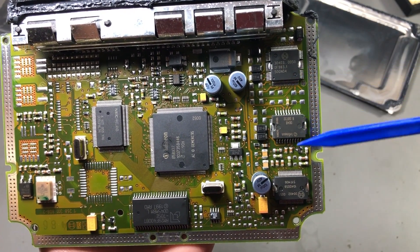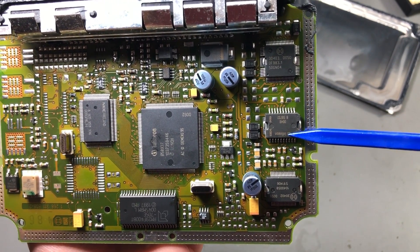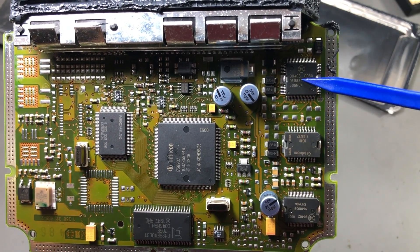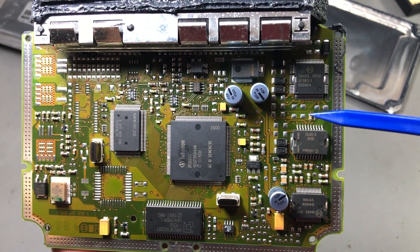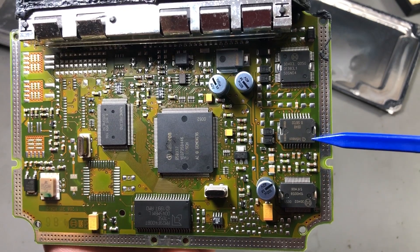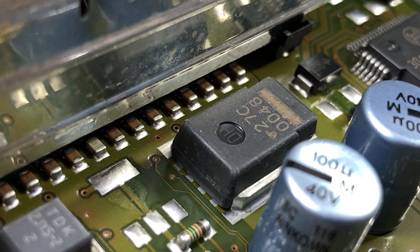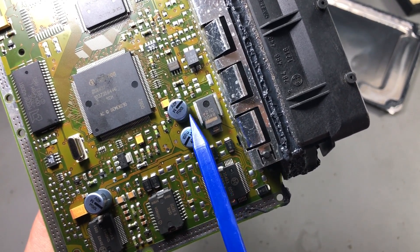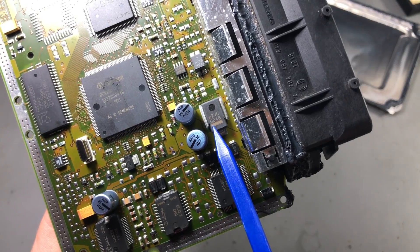On the other side we have three chips in some high-power packages, judging by the heavy thermal pads they have on the PCB. These are either Bosch or Infineon branded chips and will likely be output drivers for things like pumps, injectors, and other stuff requiring high-current switches — possibly integrating multiple MOSFETs and required bootstrap circuits under the same package. There's also a diode here — it could be a Zener diode or a TVS protection diode — likely connected on the battery input to this ECU, as we can see some heavy copper pads and big filtering caps. It's a high-power package diode, I believe it's DO-214.